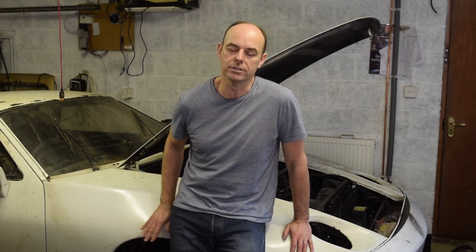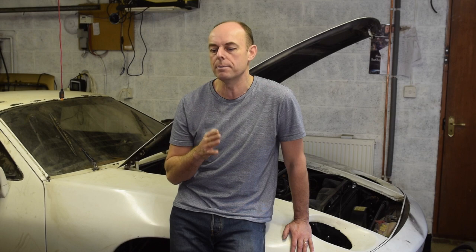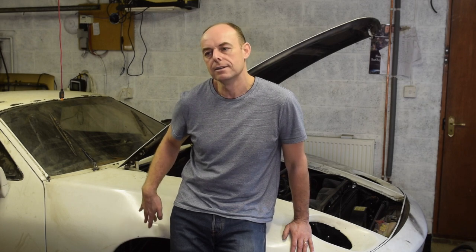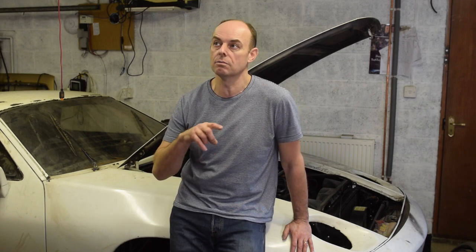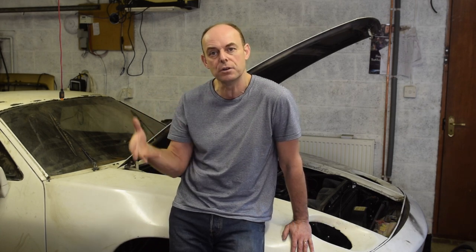I've got no idea when this car was last driven. Looking on the DVLA — the UK's driving licence database — you can look up MOTs. MOT is the test we have to do on a car every year. This last had an MOT in 2006. So if that was the last time, that's the last time it could have legally been on the road. It could have been driven on someone's driveway since then, but if we take that as the last time it was actually driven on the road, that's probably like 16 years ago. The gearbox probably hasn't been run up for that time, so no wonder it's making some weird noises. I've actually had the car out on the driveway again today and there aren't any noises — so I think it's just that fluid trying to get circulating.